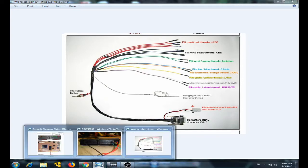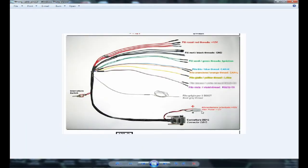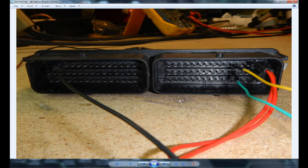The green wire is the K line, and your green wire should be connected on pin number 56. You can spot now what the actual problem is: if you try to hook up your cable like this documentation describes, you would never successfully read or write your ECU. Most people on the internet can't read and write this type of ECU because of the wrong labeling of the wires.